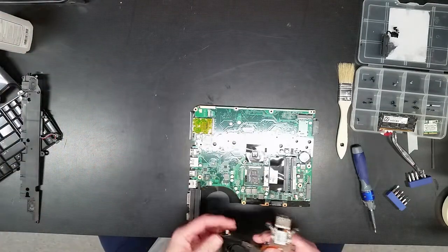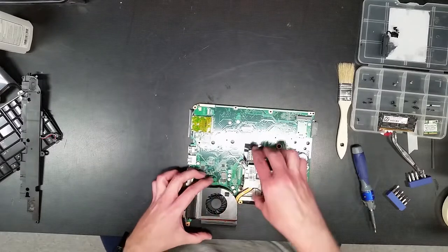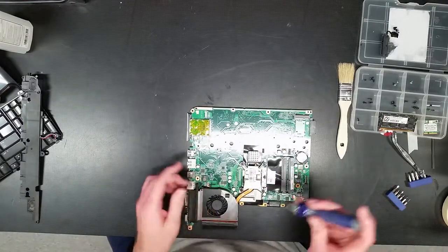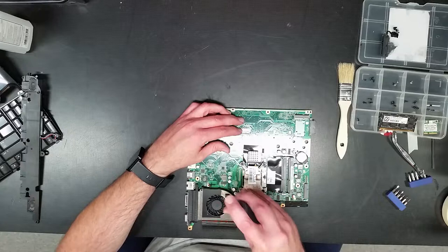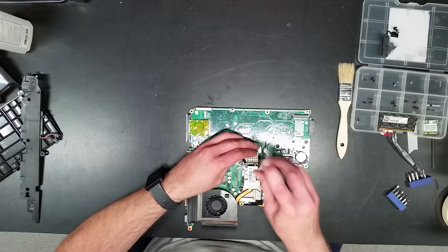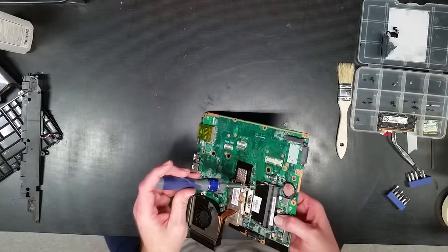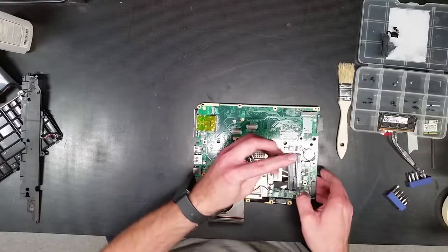Alright, so, now as stated before, put your heat sink down. Alright, now, to working order. So there's one. Just tighten it all the way down, because they're spring loaded. So two. The springs actually hold it down. I'll put even pressure on the mounting post. There we go. And it's the springs that actually do the work.